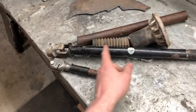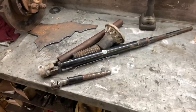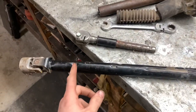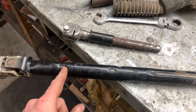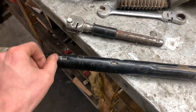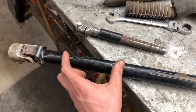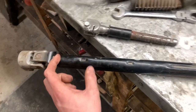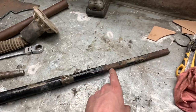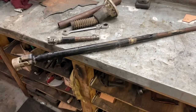I'm going to go ahead and cut this one off and take out a bit. I'll do some measuring and then confirm. I think I'm going to cut off right behind this indent here because obviously I won't be able to put a piece of pipe in there to sleeve it. I'll cut it off right here and probably here also to eliminate these two dimples. That way I've got a couple inches I can sleeve, inch and a half here I can sleeve, and whatever else I need to take off I can take off up here.